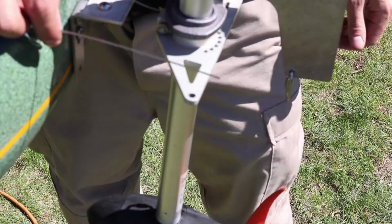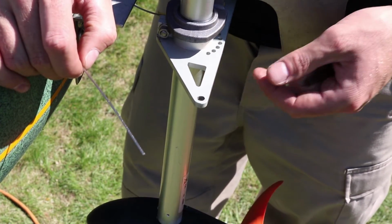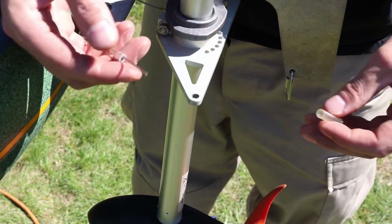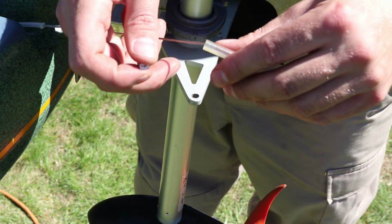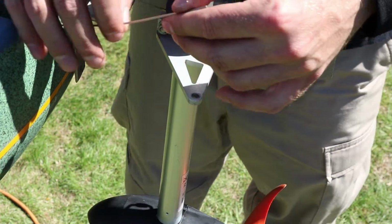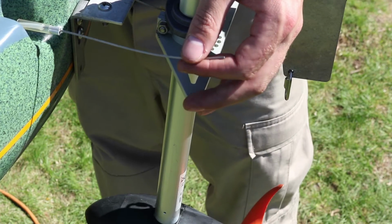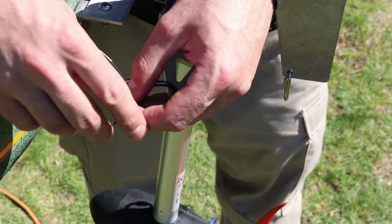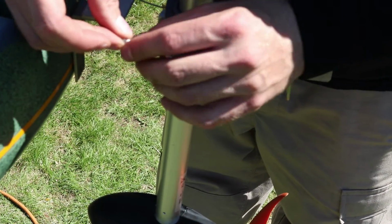Okay, now we're at the final portion of tying the motor into the steering. As you can see here, I've already switched over the steering bracket. It's now upside down. And so basically I'm going to need a swedge on here, a piece of heat shrink tubing. Actually, probably put that on first. Swedge. Okay. Now it's going to go onto here. And this just makes it so it creates a quick release. The swedge goes, cable goes through the swedge there.